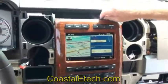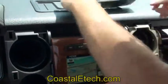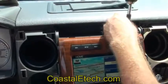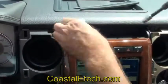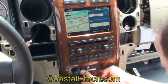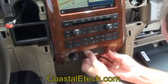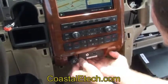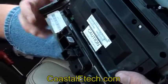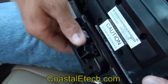Now we're going to take this rubber trim panel off right here — just kind of manipulate it and move it up out of the way. We've got two 7mm bolts up top. Now we're going to reach behind and pop this, pull it out and unplug it. On the back side, we're just going to push in these two clips on the side and then it comes free.